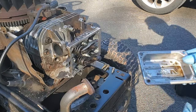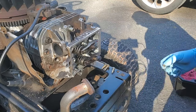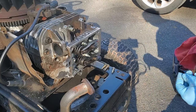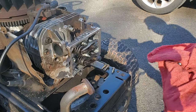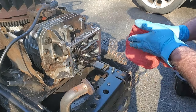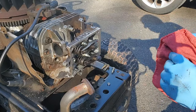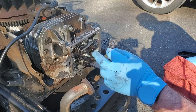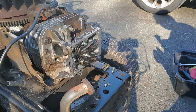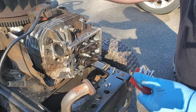I've got two little parts left in my valve cover - these two little caps. If any of you guys have done this before, you're watching to see if I make any mistakes - this was it. Out of sight, out of mind - I forgot about these. These two little caps go on top of the valve for the rocker arm to ride against, so we'll have to loosen the rocker arms, move them out of the way, and put those two little caps back on.